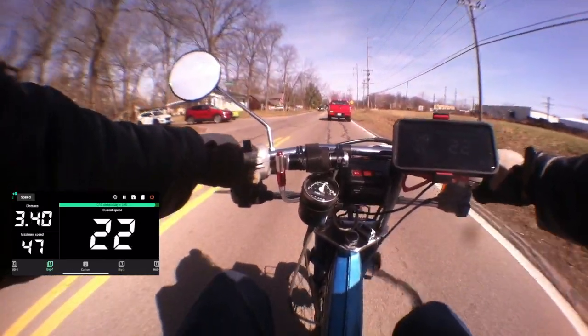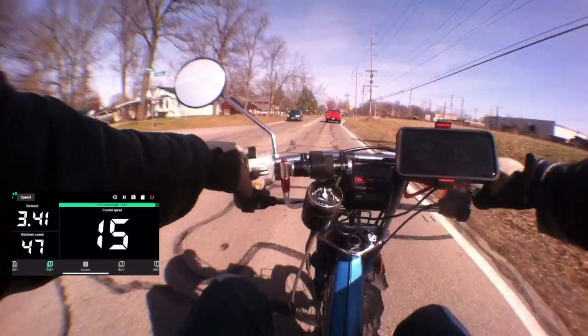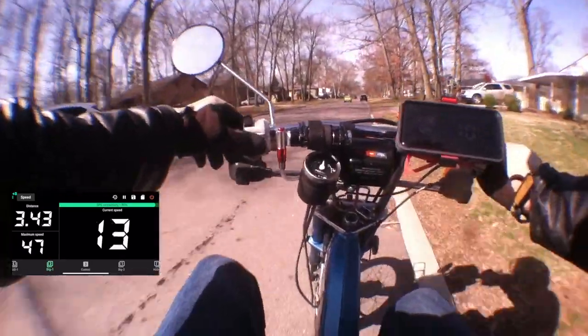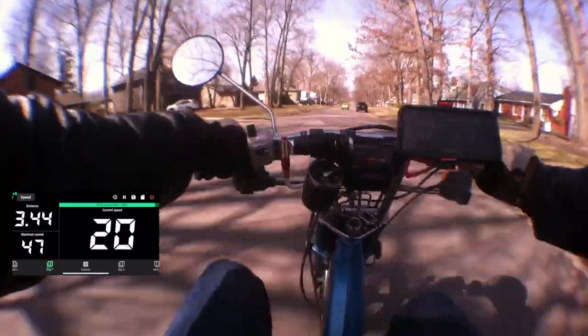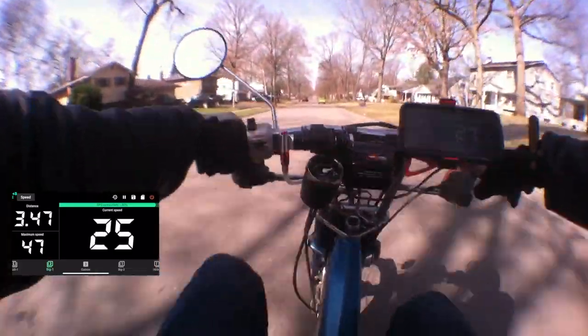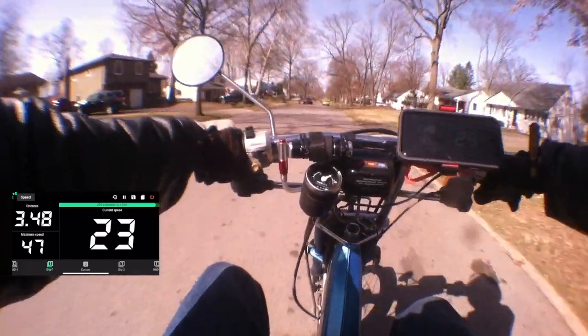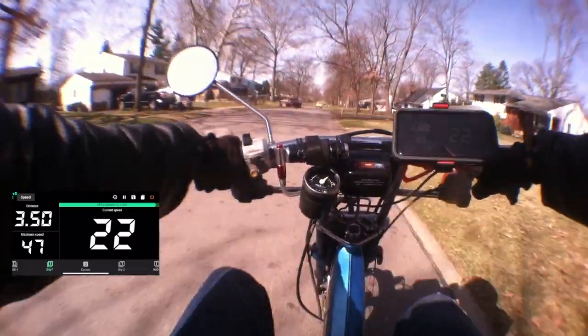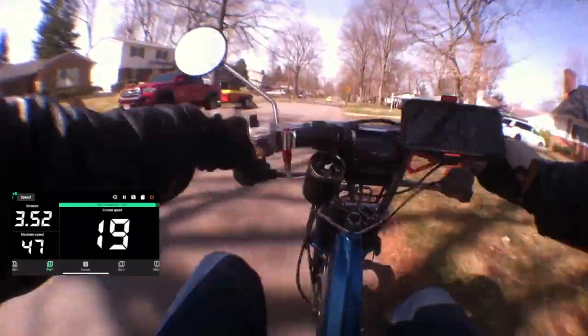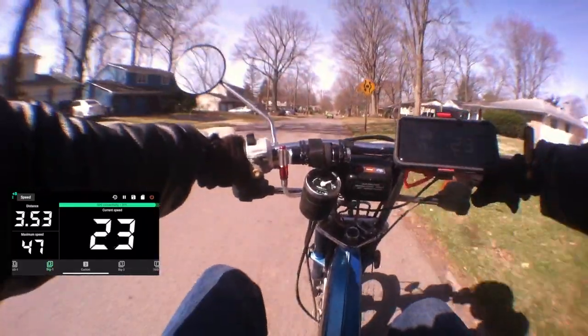And then I've got the dial-a-jet technology on the VM20 carburetor, which requires me just to reach down and turn it counterclockwise to richen the jet, or clockwise to lean it out. And actually, I do that. I think I catch that on the video, so you can see it yourself too. I think I did anyway. So, just getting things warmed up, etc., etc.